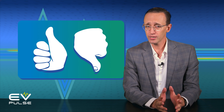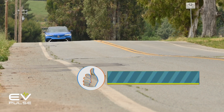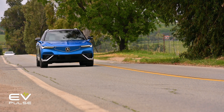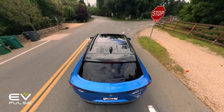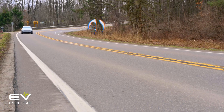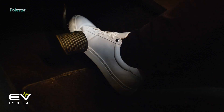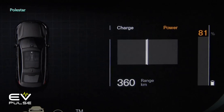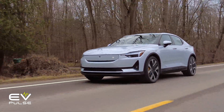What are the benefits and downsides to using a one pedal drive mode? First, once you get used to this feature, it makes driving easier — with care, you don't have to touch the brake pedal, so there's less footwork and your vehicle will roll itself to a stop and hold itself stationary. Another benefit is potentially increased range. EVs have regenerative braking, which takes the vehicle's kinetic energy and puts it back into the battery while slowing down, rather than wasting it as heat through the friction brakes.